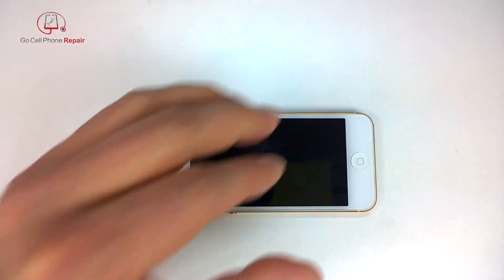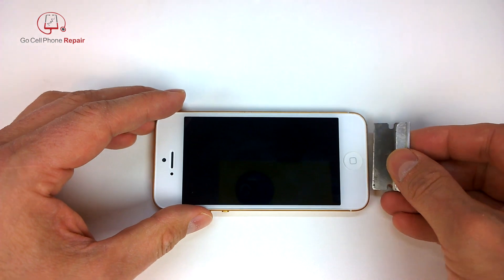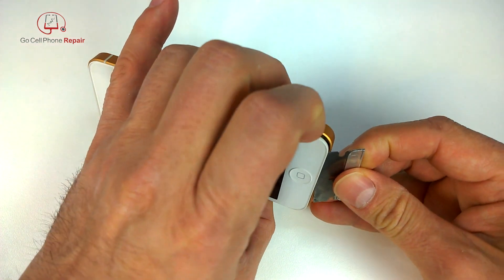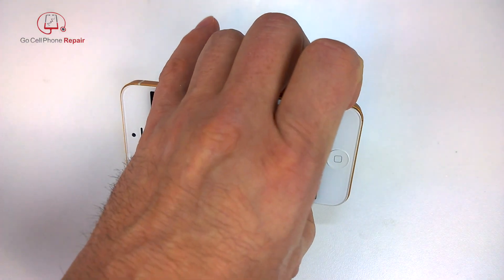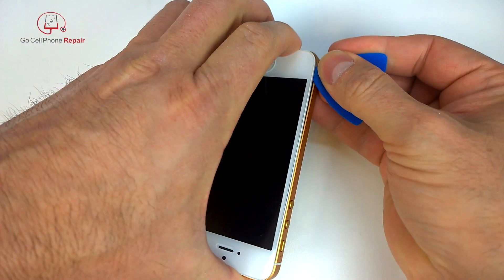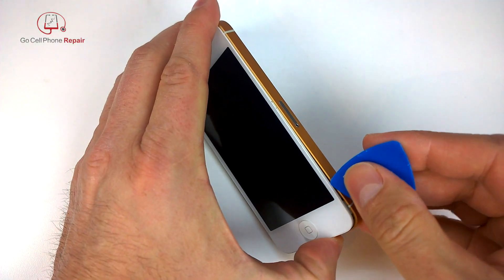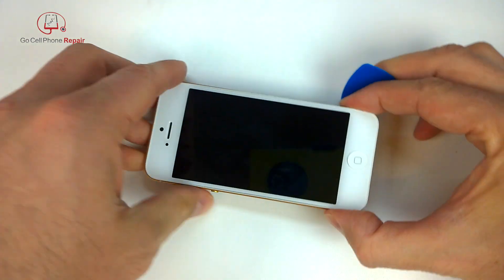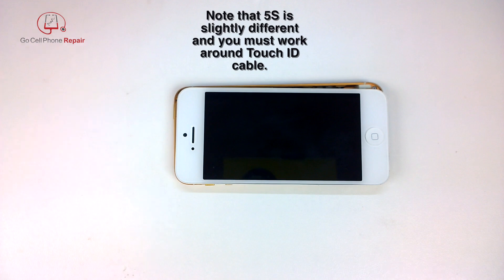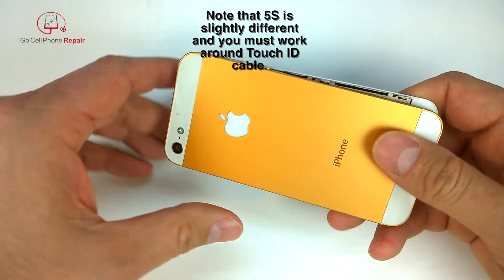I keep thinking I'm working with an iPhone 6 — these do not open quite as easily. I'll go right between the metal and the plastic bezel down here and then just prop it up a little bit. Once you've got it started it's pretty easy. This is my project phone, and this will work on the 5, 5c, and 5s. I believe all of these gasket things are interchangeable.